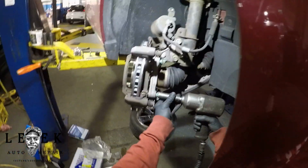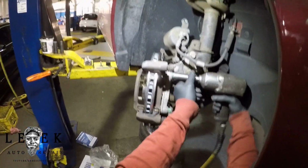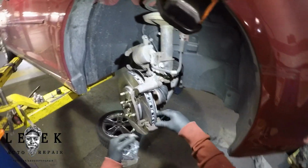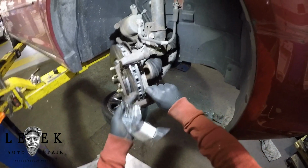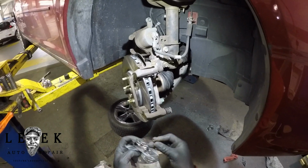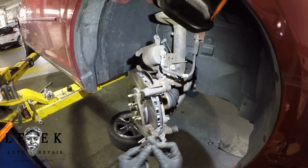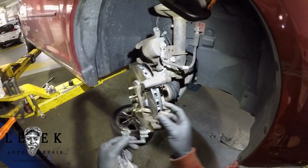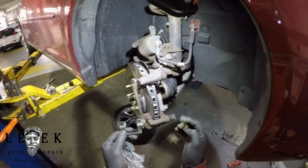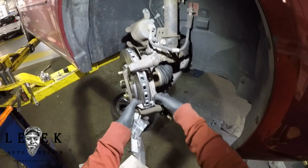So take your gun, tighten the two 15mm bolts for the caliper bracket, and then I guess I'm going to, what am I doing next? Replacing my shims, taking the bottom one off. In my pack, the shims come with a variety of different ones. I had two different sets in there in case one set didn't work. So you just gotta really pay attention to what's what. Match them up, make sure they look exactly alike. If they don't look alike, I wouldn't use it.